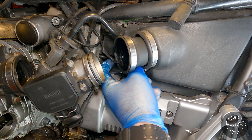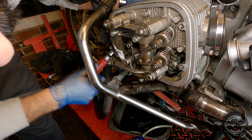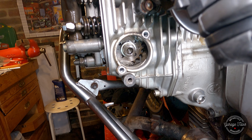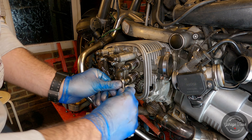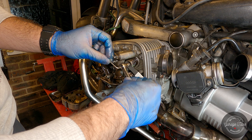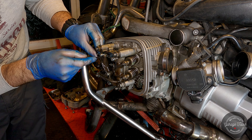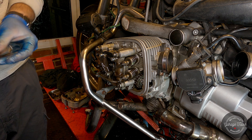Now I can remove the crankshaft locking tool. Just checking if the engine spins nice and freely — which it does. Putting it back at top dead center and checking the markings on the camshaft pulley are still horizontal. Now it's time to quickly adjust the valve clearance — they're all pretty tight, so I'll start by loosening them off and setting the clearance correctly. I won't go into too much detail here, but I've got a separate video on adjusting valve clearance on my channel. Once happy with the valve clearance, I'm also checking the end floats — always a good idea to check on top of the rocker, not on the bottom side. All good here, so no adjustment needed.